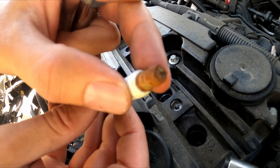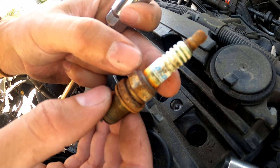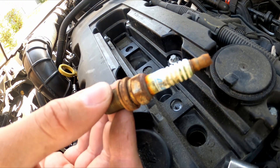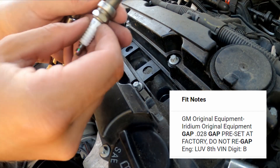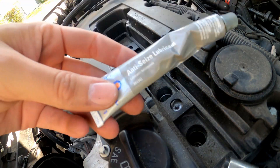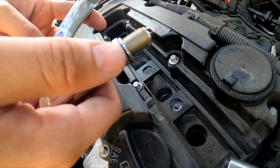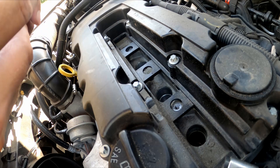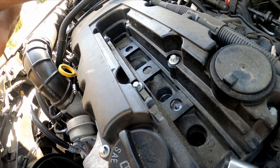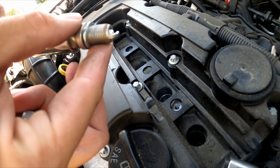As you can see, the top of this plug is really, really badly rusted — so that's probably what was causing the misfire issue right there. Next we're going to install the new plugs. These are pre-gapped to .028. It's also a good idea if you have anti-seize to go ahead and put some on the actual threads themselves. This keeps it from seizing up in the motor and makes it easier if you ever have to change the plugs again — you don't need a ton, just a little bit.